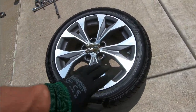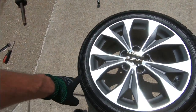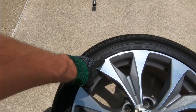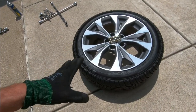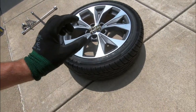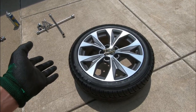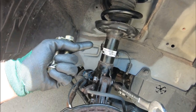For those of you that don't know, these are my 2012 SI wheels. Factory tire specs for this are 215/45/17. When I was replacing these tires a few years ago, I decided to go up one size to 225/45/17. Ever since I went up a tire size, the handling has gotten worse and worse. That extra meat on the tire means more flex during turning, so my response has declined tremendously — I really changed the whole dynamic of the vehicle.